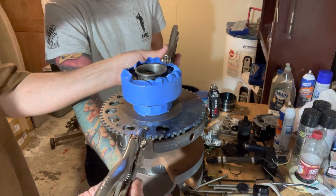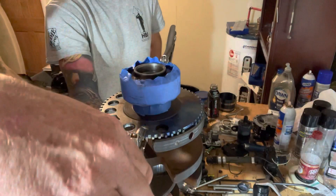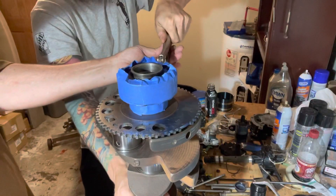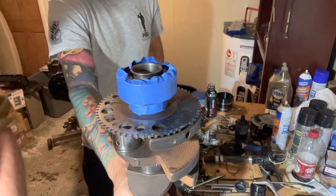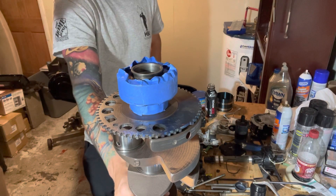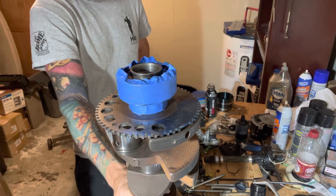So let's see if it's cooled down. It's locked on — it's turning the crank. I'm going to go ahead and remove the vice grips now. And I think we're a success. We have now removed a 24-tooth trigger wheel and installed a 58-tooth trigger wheel on a 2000-2001 6-liter crankshaft. We've effectively converted this from a Gen 3 to a Gen 4 crankshaft.